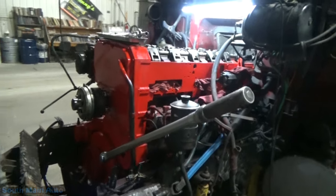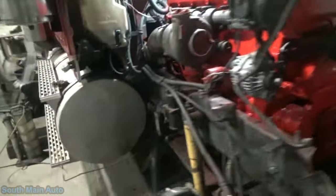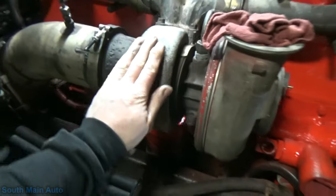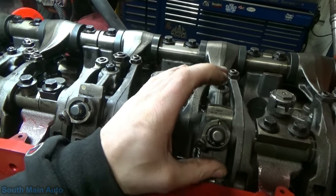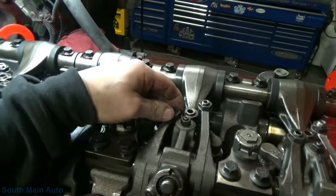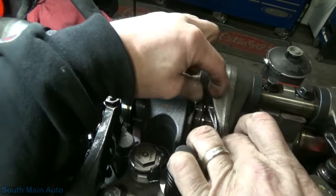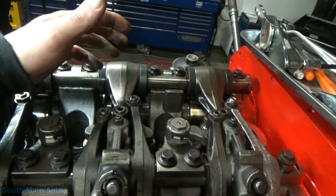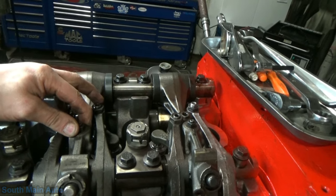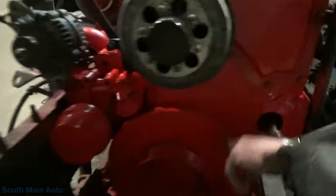There's the engine — not all the way together yet but at the point where the valve adjustment needs to be made. He's got a barring tool in the front of the engine, which is essentially a big jumbo ratchet. We've got the big turbo snail up here, and these up here can be your Jakes — your engine brakes. Then we've got intake, injector, and exhaust. We're not at top dead center when we make the adjustment. The marks are on the harmonic balancer — three positions.